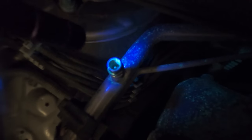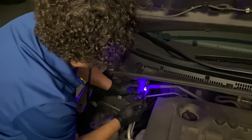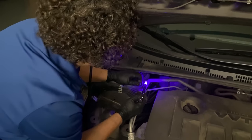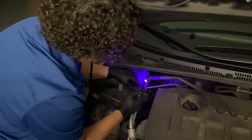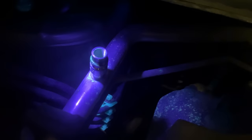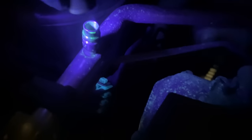It's pretty common, if you've ever had your AC system worked on before, to see a lot of green dye around the valve — because the end of the lines on those machines have dye going through them all day with the Freon and it leaves residue behind. You can clean this, and if it comes back — especially inside — use a cleaner solvent, blow it dry, and make sure it's clean. If the green comes back inside, you're going to need a Schrader valve.